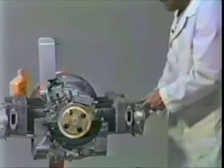Set the torque wrench to 15 foot-pounds initially, and torque in a pattern that's listed in Secrets of the Inner Circle. Like I say, alternate between two torque patterns. If you follow this carefully, you can see which ones they are. You start at the middle and then work your way out to the outer head nuts,